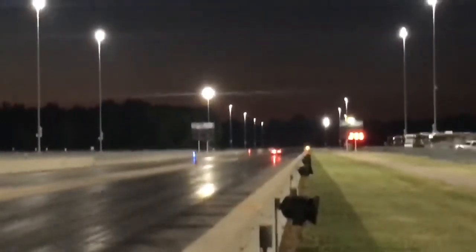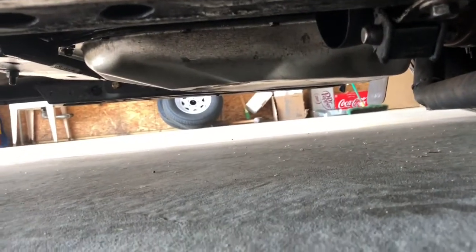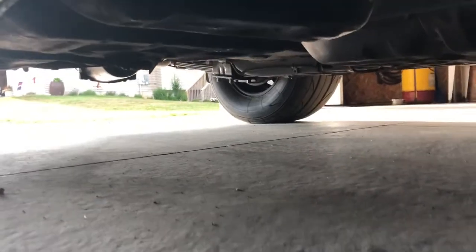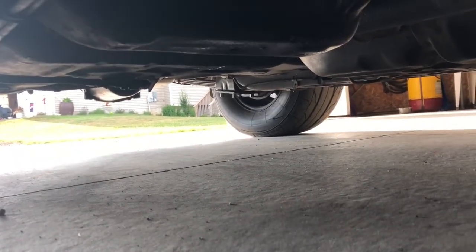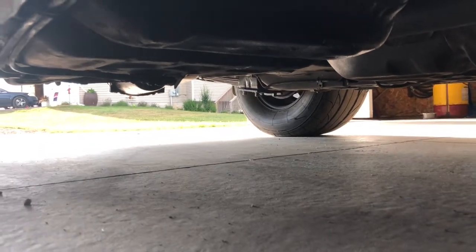I believe this one was a 12-1 pass. It's got a 480E transmission, bone stock right now, stock converter, which is kind of a setback. And it's got a Pontiac 8.5-inch 10-bolt, 373 gears and a posi out of a Trans Am. Does pretty good, still spins both, so we're just going to run it.